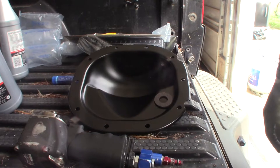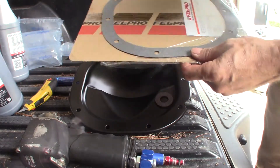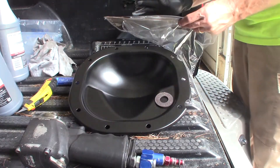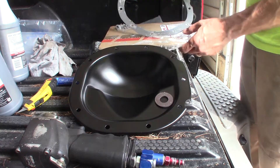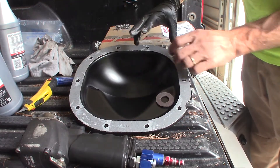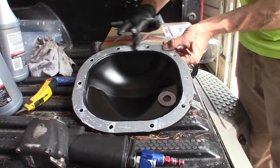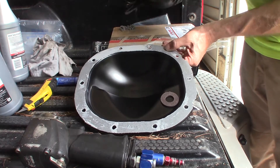Alright, new cover's in, my gasket — I'm just gonna put a thin coat of silicone on either side of my gasket. Real thin, not much at all, a real thin layer. Put it on there and we'll put it back together. Same thing on this side, very thin coat, not a lot. Probably could do without it but I like to use it as an extra precaution. We'll torque it down and let it sit — I like to let it sit at least an hour to dry.